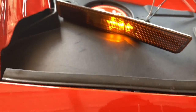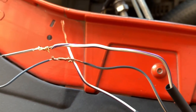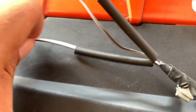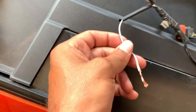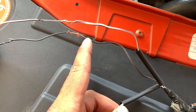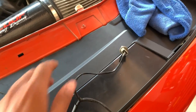Before I keep going I want to show you that yes, it actually does work. The way you want to connect it: on the 2015 harness you've got a white and brown wire — connect that to your pre-2015 purple and white. The second wire on the Hellcat harness looks black and gray, almost dark blue — connect that to the black and white on your pre-2015 harness. The second purple and white you don't need. Make sure you put heat shrink on before you solder, because then you can't put it back on. All we have to do now is put the heat shrink on the right wire, solder it up, do the same on the driver's side, and we're good to go.